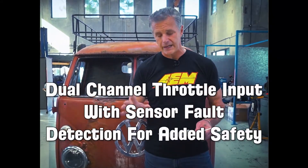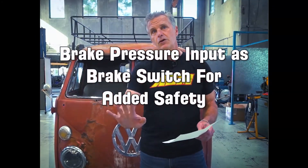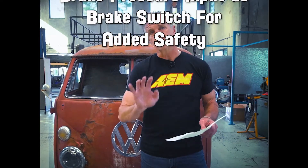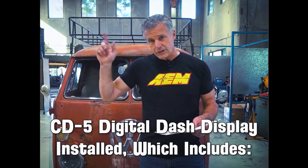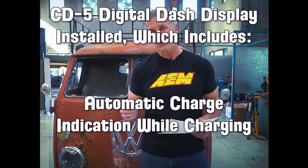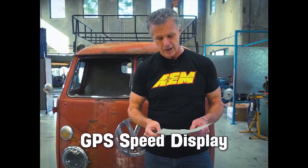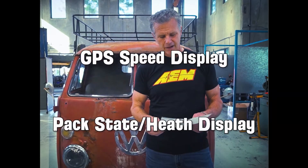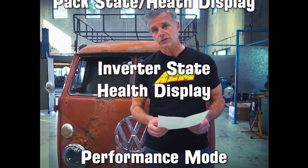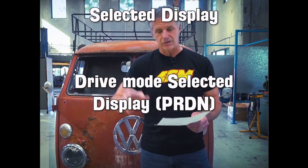Creep mode and hill hold have now been added. Throttle bounce has been filtered out for a better, smoother transition, especially when you're bouncing down the road. Regen based on brake pressure and on-throttle based on throttle release — so you have like an engine decel but it's actually regen. Dual channel throttle input: two sensor inputs into the VCU for added safety and redundancy. Brake pressure input to the brake switch for additional safety — meaning if there's no brake pressure you can't drop it in gear, and if there is brake pressure you can't use the throttle, so you get zero torque demand. The CD5 dash is now installed in the center with automatic charging display, GPS speed, pack state and health, inverter state and health, performance mode selected, and drive mode selected.